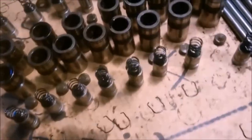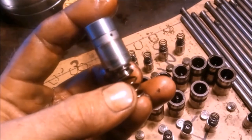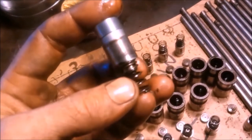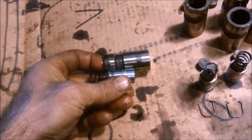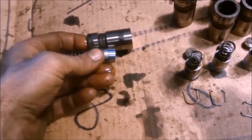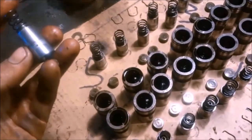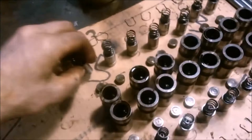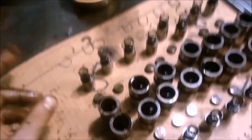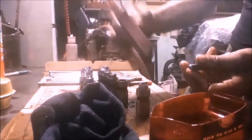They should all have a nice round pattern in the back because they're rotating like they're supposed to be. Check them out — you might have to replace one or two. You can see the wear marks where it's riding. Check each one to make sure one hasn't been riding in a different area than the rest — that one's probably bad. If you can't get any of them to pop by cleaning them, you're going to have to replace it.